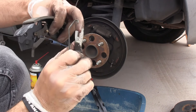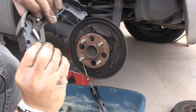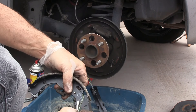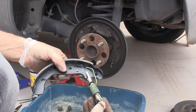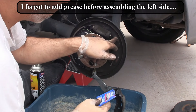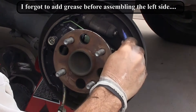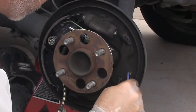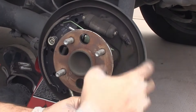See that little notch there — if I put this back together, I'll make sure the notch is on the side that the pin goes on. So it should look like that. Did you see the spots where it was touching? Right down here. So I'm going to put a little bit of grease on those spots. Of course don't get this on your hands, and absolutely don't get it on the friction surfaces.